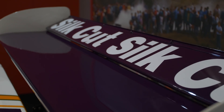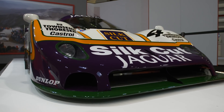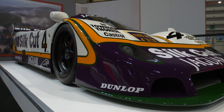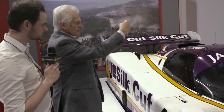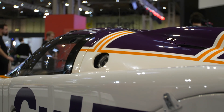On top of that it needed a very strong structure to carry all this weight, because these things develop a lot of downforce — much more than a Formula One car, certainly in their day. Massive loads. So it had a full-width monocoque — I'll show you — the monocoque structure goes right across. That's your chassis, it's not just bodywork; it serves two jobs. As you can hear, it's solid and goes right across, giving you massive structure.